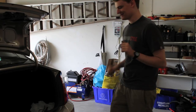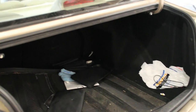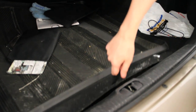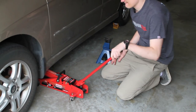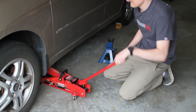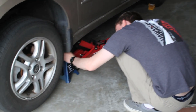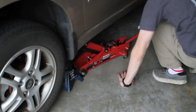If you don't have a floor jack, you can use the jack that comes with your car for changing tires. In most cars, just lift up your trunk cover and there should be a kit sitting on top of your spare tire. Find a flat surface, engage the e-brake, put wheel chocks behind the back tires, then jack up the car. Refer to your manual for jacking points — usually the frame rail on the side is a good spot. Then throw the jack stands underneath the car.